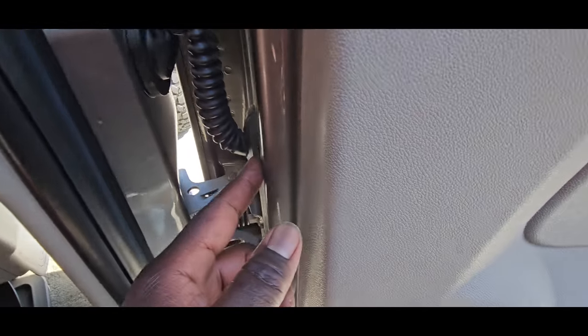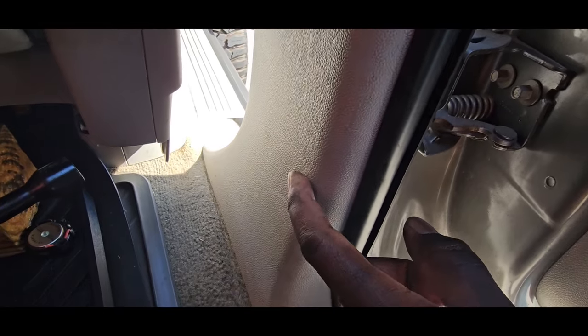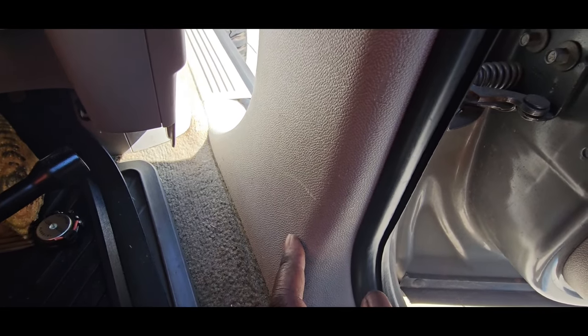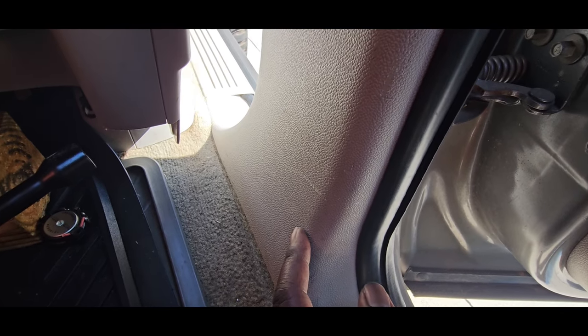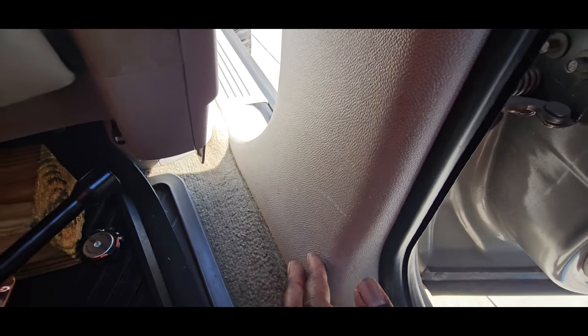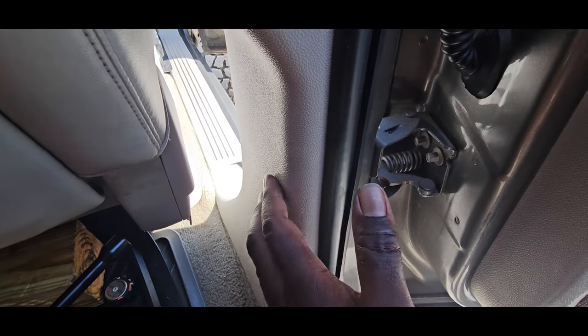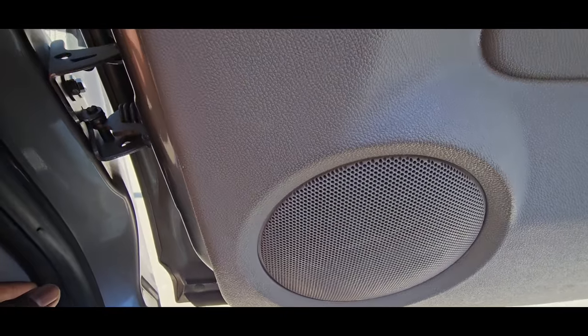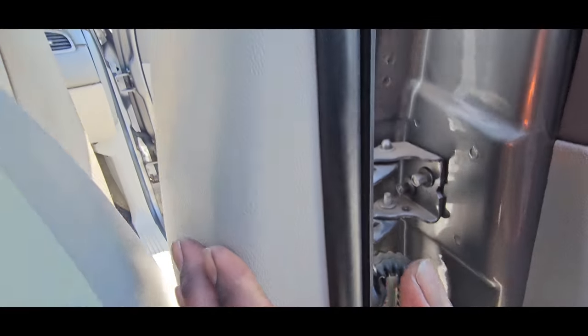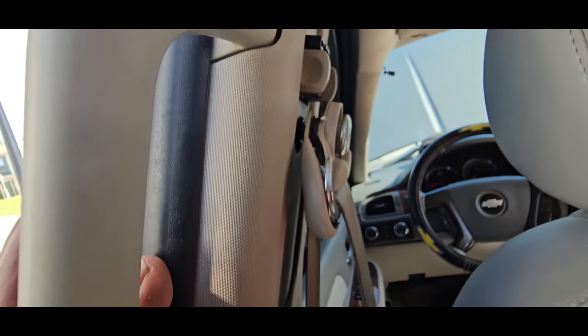The speaker wire from the passenger door rear goes through here and it's down at the bottom inside of here. You have a light blue and a dark blue wire — the dark blue is the negative, the light blue is the positive. All I did was connect the speaker wire to those wires. So basically the tweeter on this B pillar is connected to this speaker right here. These tweeters — the wire that's on the tweeter is kind of short, so I had to solder a longer piece of wire on it to run it all the way down here.